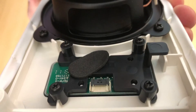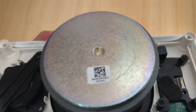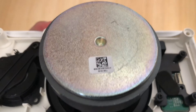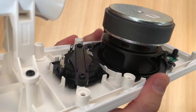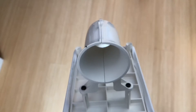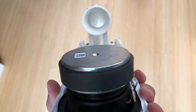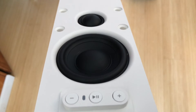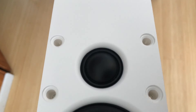Taking a look at the front panel assembly, you can see the woofer — it's got a pretty beefy magnet structure on it. The frame is stamped steel, the cone is probably polypropylene. The tweeter seems to have a small magnet, so it might be neodymium. Here's another view of that curved port. Looking around the front: very simple controls, a really clean-looking design, and the port at the top.